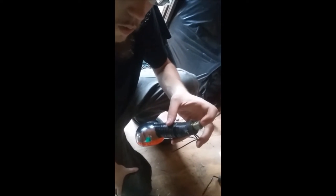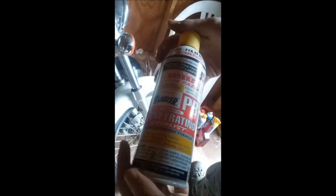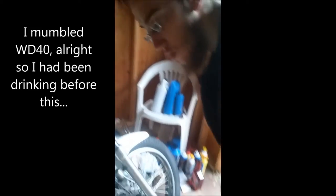When I pulled these out, the guy had twigs stuck inside and wrapped with electrical tape — don't cut corners with stuff like that. Basically how these seat into the rear pillions: this broken piece actually slides into the pillion, and from the bottom of the pillion there's a Phillips head screw that unscrews and pulls it out. However, because water collects in the pillion, they like to seize — they're a pain to get out. I'd recommend using some penetrating oil; PB Blaster is decent stuff. You can use WD-40 if you want, but a proper penetrating oil is better.